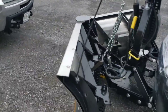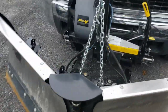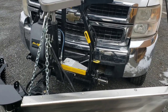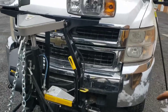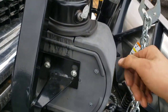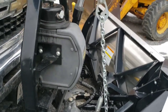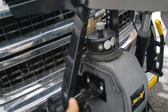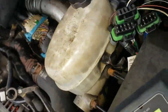I just wanted to pop a quick video out there for you guys. I was having issues when I would hit the plow remote - the truck, I'll show you in the garage, but basically this box would make a lot of clicking sounds like the relay was fluttering. Lights would come on on the plow but it wouldn't lift, it would just click.